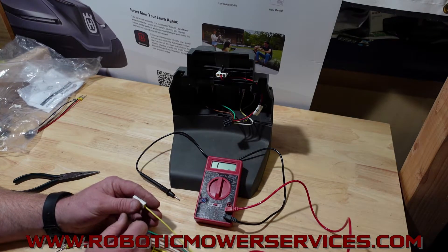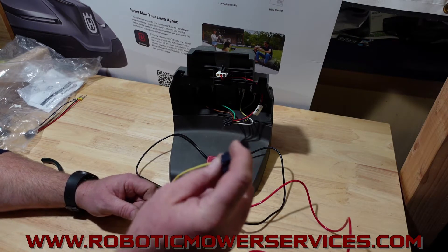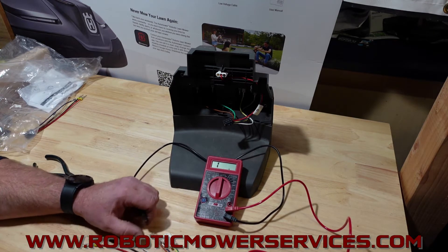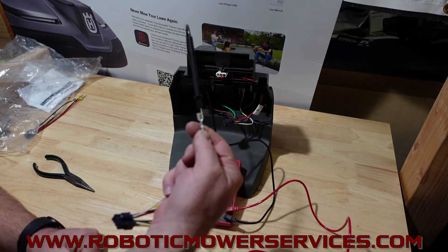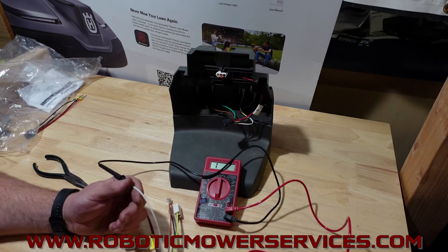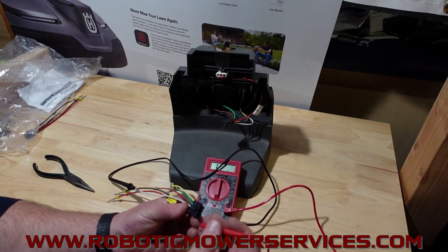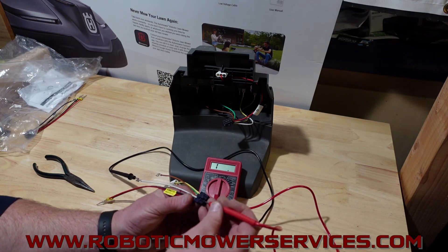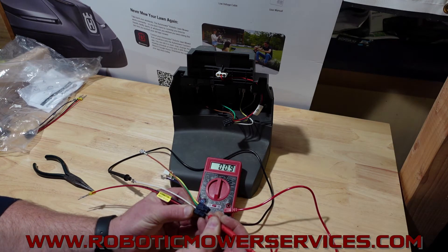So you get yourself a multimeter, set it to the ohm scale, and you're just going to measure the resistance from one end of the wire to the other. We'll check this white wire here — put one probe in the end of the wire, find the other end of the wire where it's in this connector, and we should have one ohm or less of resistance through that wire. There we go, we're at 0.9 — actually 0.8 if we wiggle it around in there.